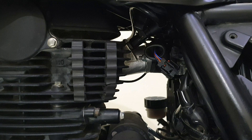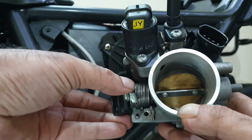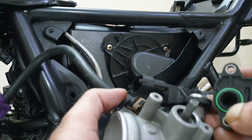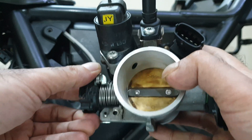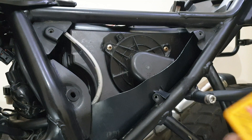If you've cleaned the throttle body and took out the position sensor, you want to check where it needs to be adjusted because if it is too far off, it won't give a proper reading. I have a KTM throttle body here as an example. You can see this butterfly valve — it is connected to a shaft. When you accelerate, the throttle plate and butterfly valve open, and this connects to the TPS sensor which has a groove that slots in, so once you rotate it, it rotates the sensor inside and gives feedback to the ECU.